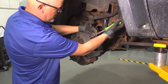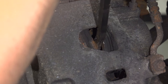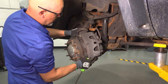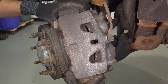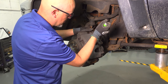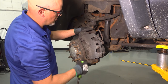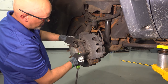I'm going to take a pry bar and just pry the caliper — that's compressing the pistons back into the caliper. You can see if the slide pins move. It seems like both pins are moving, so that's good. Now the caliper piston on the bottom seems like it's sticking compared to the top. The top moves in a little easily, but the bottom one is sticking. It's a lot harder to force that one in. So that could be what's going on. But we also want to check out the pads to see if they're stuck in the bracket.